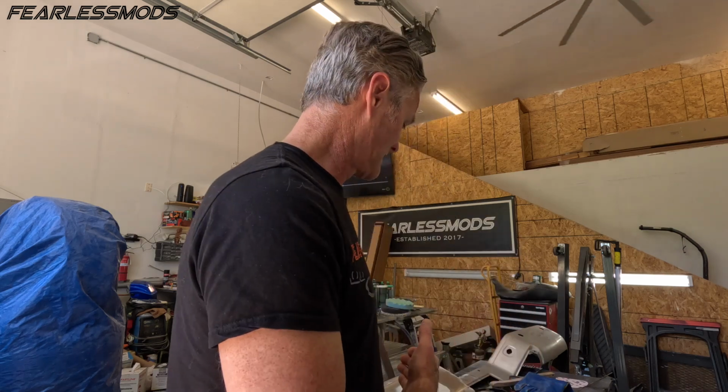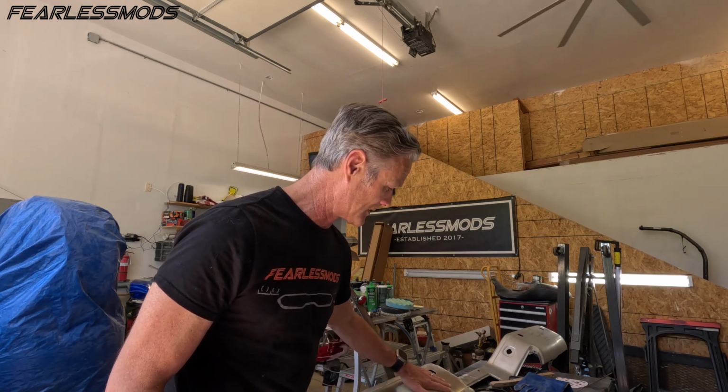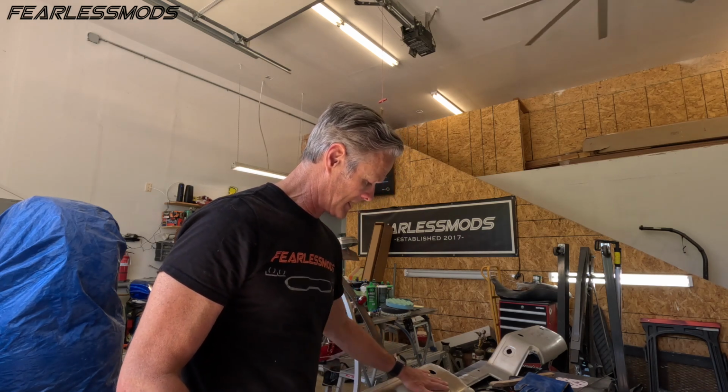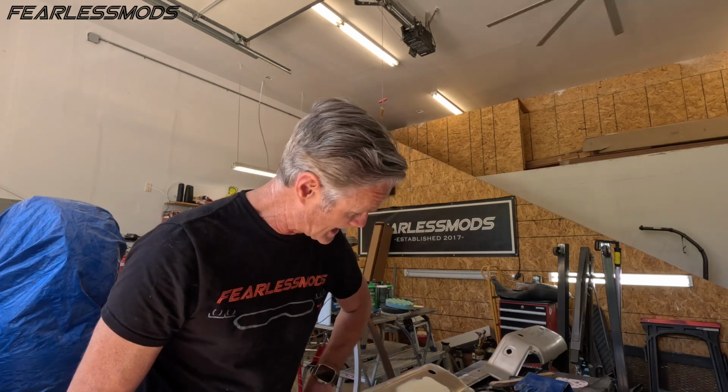I haven't touched this in far too long, and I want to get the epoxy primer laid down so it has time to dry, so that I can sand it before we put the silver base coat on it. So I'm going to mask up so that I don't breathe in all these sanding fumes. We're going to lay down some more body filler. I was a little aggressive on the sanding in some areas, and I feel some contour from where the chrome meets the Bondo, and I want to round that out a little bit more so that it's not such an abrupt transition. Not sure how good I'll be at it, but we'll give it a shot and do some sanding, and by the end of this day I plan to have this thing primered black. Let's get to it.